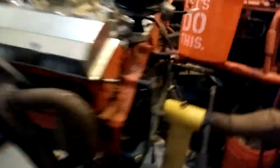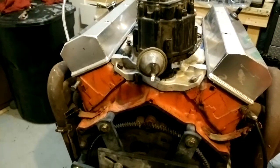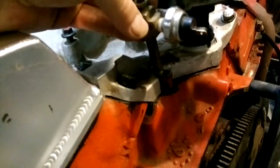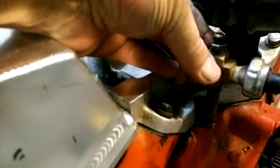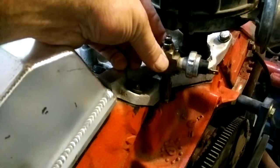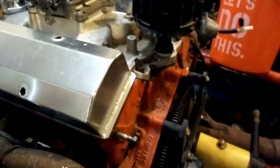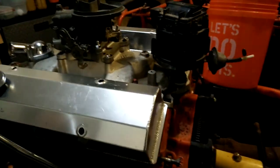It's got the headers, it's got the starter, it's got everything in it. I need to put the distributor in, but there's a small problem — I've got to get this oil pressure doohickey out. The old one goes right here, but now with this big-ass HEI distributor, I don't think it's gonna fit under there. We might have to shorten it or something — it's gonna be stupid close. I also need to put the distributor in on the right teeth, because it's just thrown in there right now.